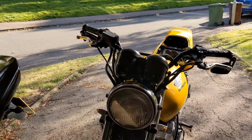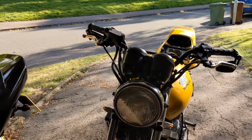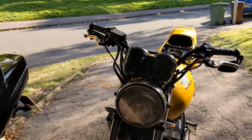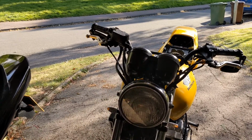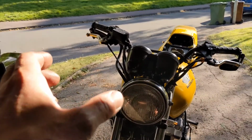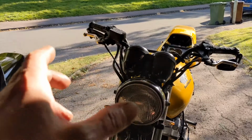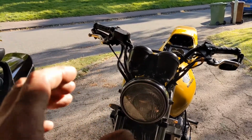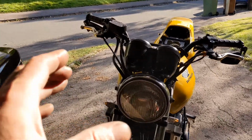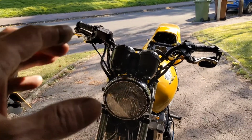I dug out the old knackered ones, and they were originals, and I could just about, with effort and a little bit of sanding down, make out that they were 95s and 98s. Remember, this is back in the day when if you got a 4-cylinder bike, they used to put different jets in the middle two than the outside two, because there was a concern over heat generation and heat retention. It's been pretty much debunked as I understand it. Anyway, I've gone up to 100s, I've chucked them in.